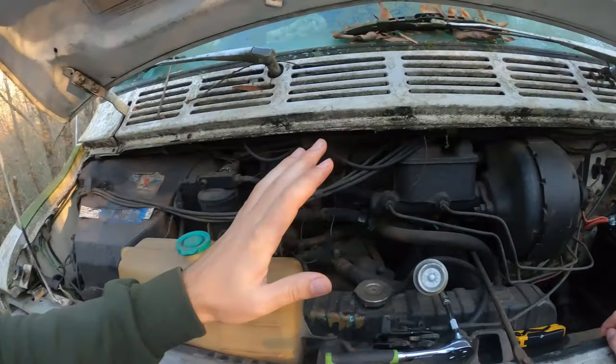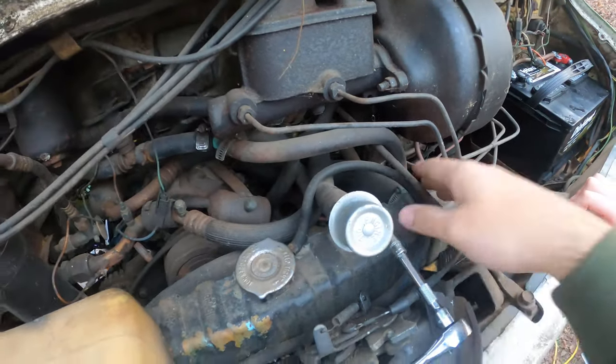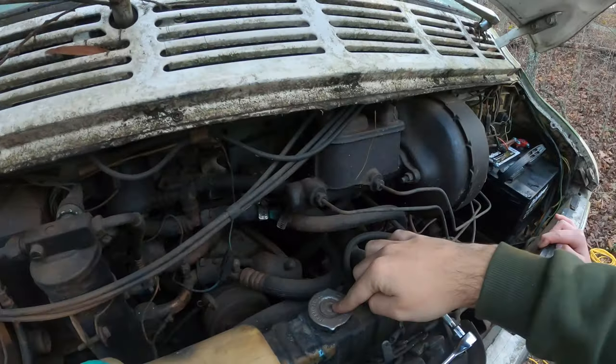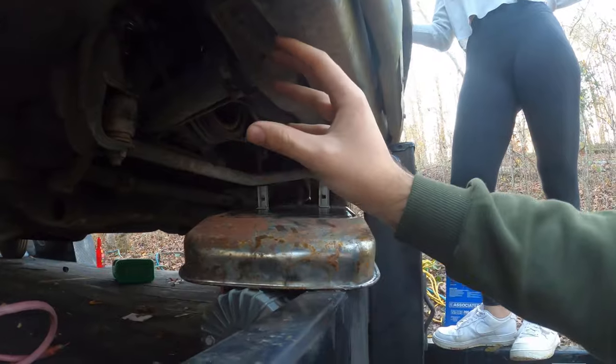On this particular model, the van which is the B300 base, the radiator is located in the front like all vehicles. Right here we have your radiator cap, your radiator inlet hose going to the thermostat to the engine, and then we have your lower radiator hose at the bottom. To flush the radiator, we're going to remove the bottom hose. We'll put water in the top and all the built-up gunk will naturally flow down with gravity and flush out through the lower hose once it's disconnected.